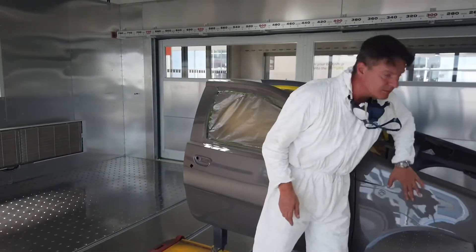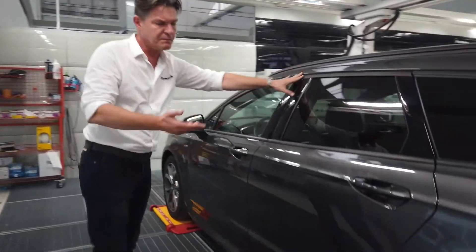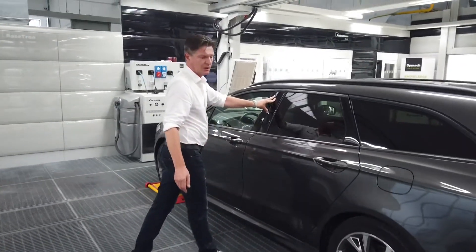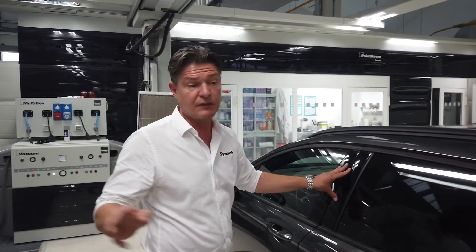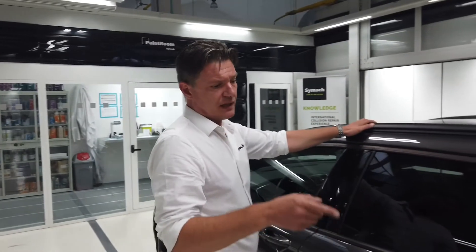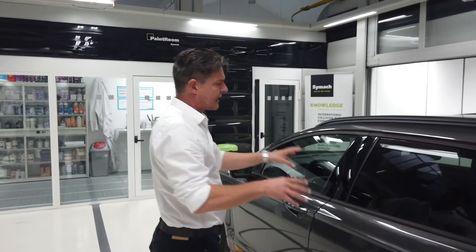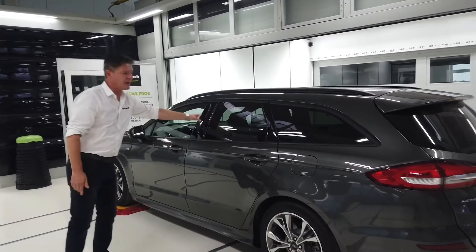As you can see, it's completely dry and very easy to move the car through the line. In that way, it's possible to move the car without any congestion or bottleneck through the different phases: filler, primer, primer sanding. Another advantage is that especially when you arrive in the last bay — the masking bay — you can mask the car completely, so the car is ready to paint. After this, you're ready to paint. That's it.